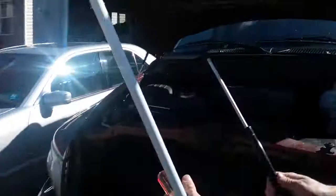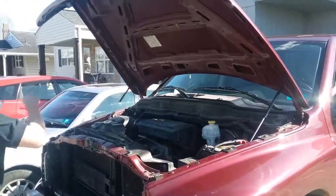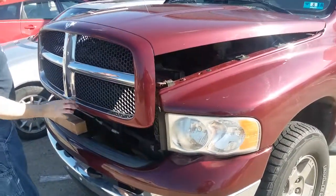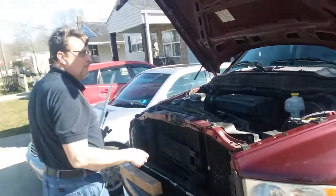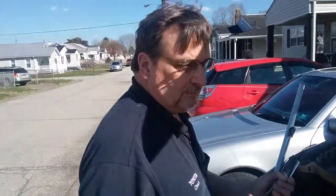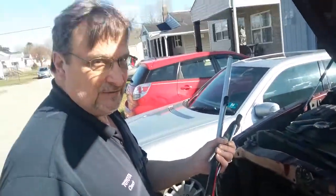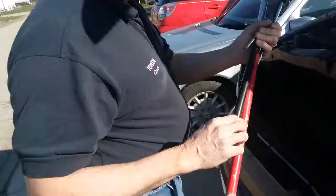Let's see if it closes. All right — oh yeah, much better. So what was happening before? It was just not opening right? Before, in cooler weather, this is a 2003 truck, obviously, and it's 2018 so it's 15 years old. The shocks basically were just worn out, and when you tried to put it up it would not hold, especially when it was cold.